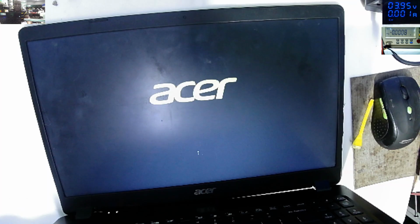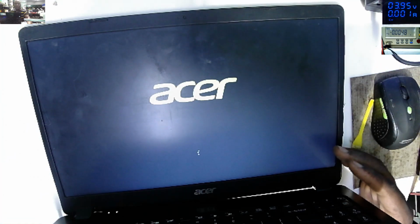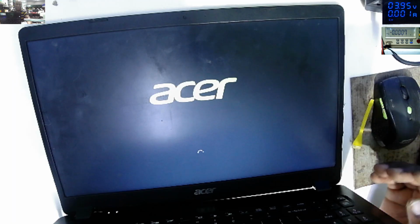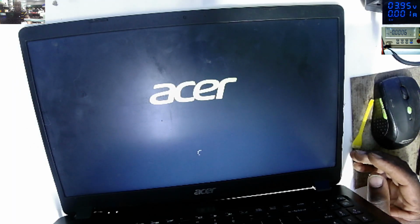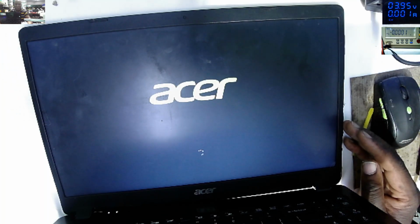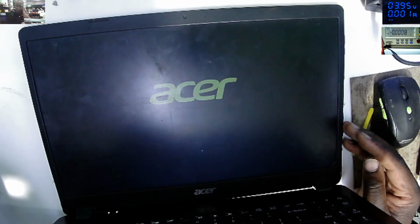After that, I'll put all the screws to do the cleaning process. But the most important part is our laptop is now working. So what they did, they were putting screens, checking out, probably while it is plugged on power, and they blew up the 19 volts fuse, which is going to the screen.